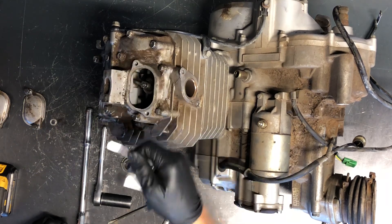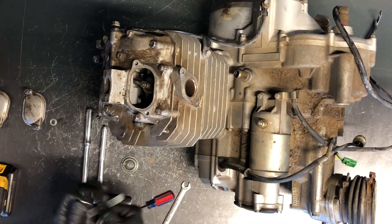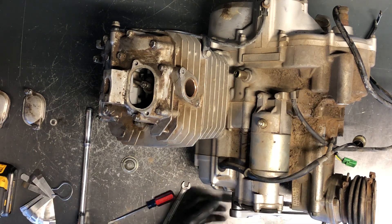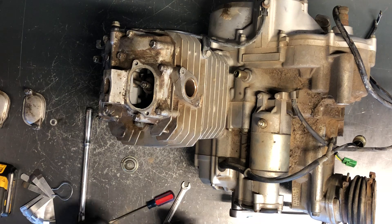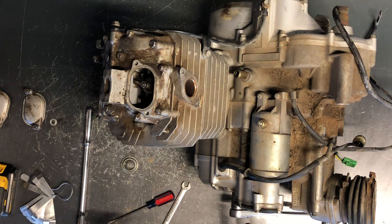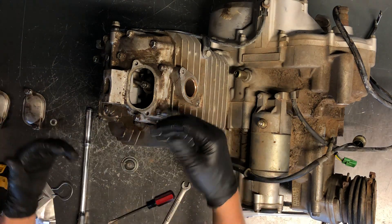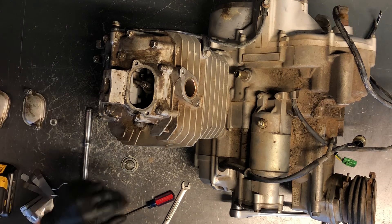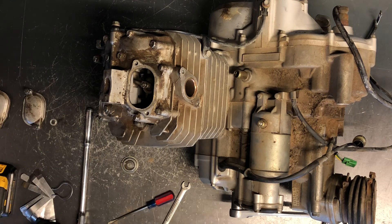I can't get the 0.007 in there, so I know that's where we need to be. What I like to do then is spin the motor all the way around a couple turns, then find top dead center again and double-check it — just to make sure I was on the correct stroke the first time and there weren't any complications. Double-check everything before buckling it all back together.